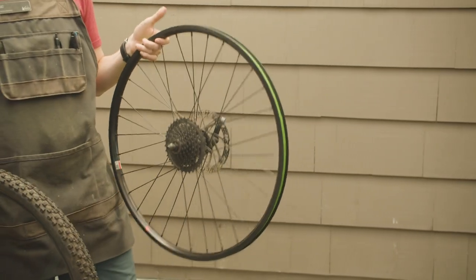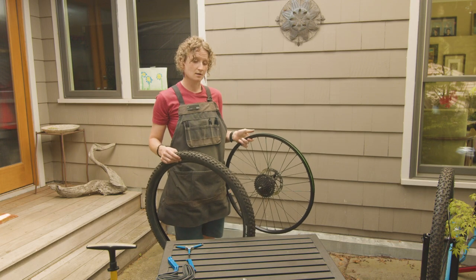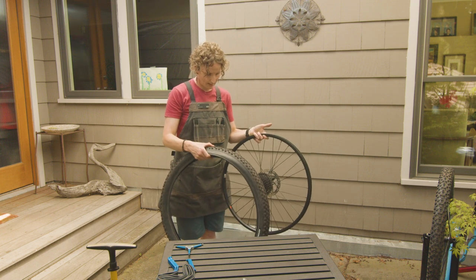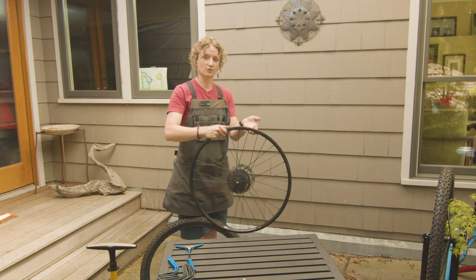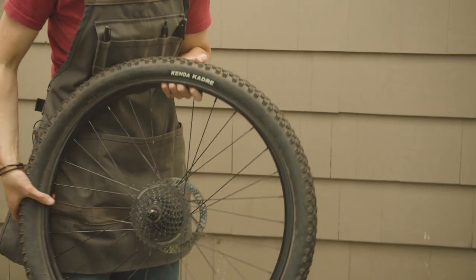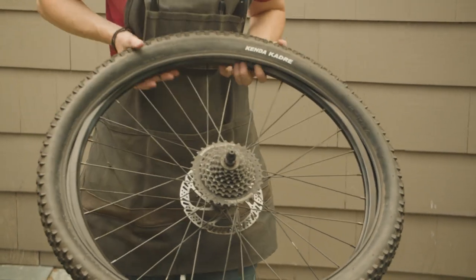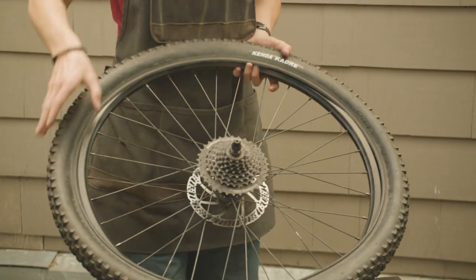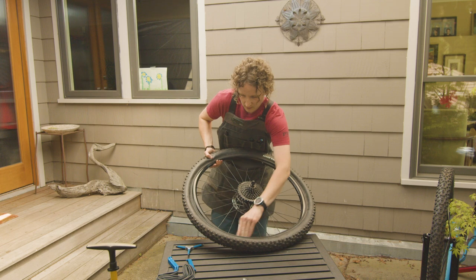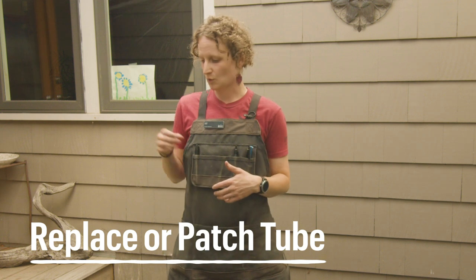So now that I know that my rim and my rim tape is in good shape, if there was anything still left in your tire, you've removed that. Just be careful with your fingers. Sometimes, especially if you do a lot of road riding or commuting, you might get a piece of glass that's still stuck in there. So just be a little careful as you're running your fingers on the inside of your tire wall. From here, I'm going to put one side of my tire onto the rim. Usually I just work both sides around until everything fits in there nicely. So at this point, we are ready to replace our tube